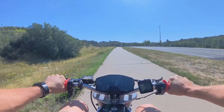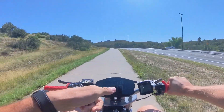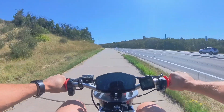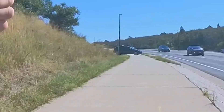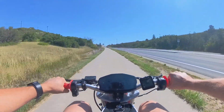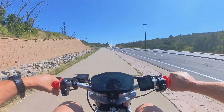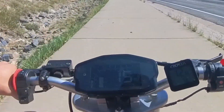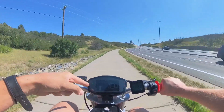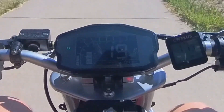The DKD shows a handful of things — you have to tune it correctly for your bike and wheel size. It shows battery life, amps, miles per hour, and your different speed modes one, two, and three if you have a three-speed switch wired in. It shows your trip and odometer to track miles. The amp meter reads times 10, so right now pulling around 10 amps, but it'll jump up to 30 when I get on it.